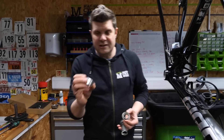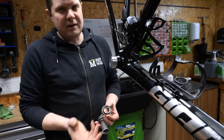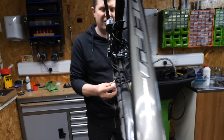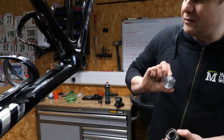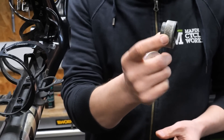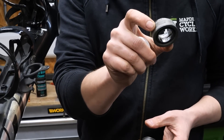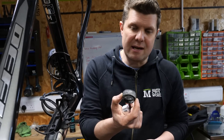Just to illustrate the point: these are the hand gauges - on this side 40.5, a nice fit. On the non-drive side this is the 41 millimeter and that rattles. So what we're going to do is carefully extract that, give it all a really good clean, bond it back together, let it cure, and then refit a bottom bracket.